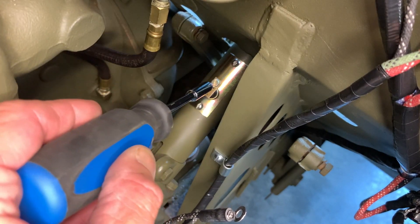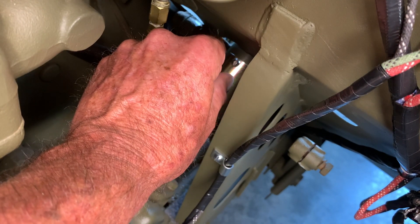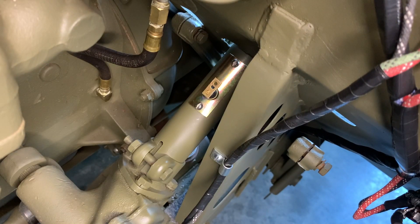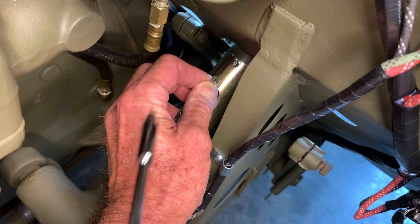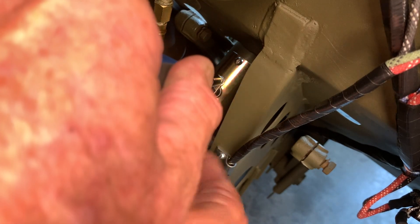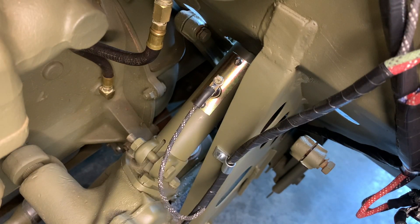Now install the black wire with the two white tracers — from the short left-side wiring video — that we left loose. Move the screw and star washers out from underneath. That star washer likes to jump off and land on the floor, so keep your hands nice and tight on it. The star washer will cut nicely into the wire and make for a good contact. To make it simpler, install the screw and star washer onto the eyelet of the wire first, then use the wire to hold everything in position as you get in with the flat head screwdriver. Hold the wire straight up and down before fully tightening. Important warning: if you ground that area, your horn will sound continuously — on my CJ2A I learned this the hard way. A wire was touching it and my horn just sounded off for no reason.